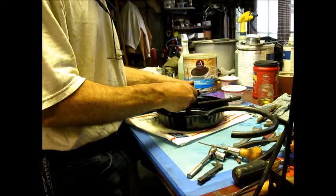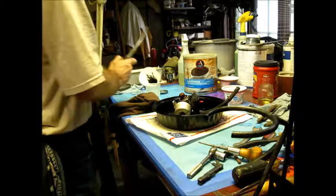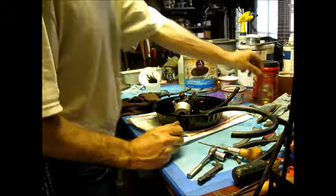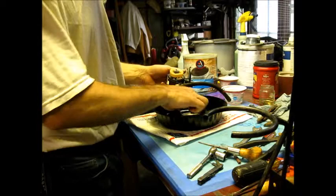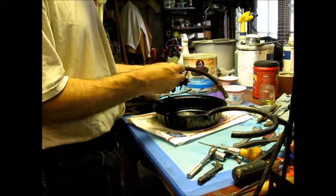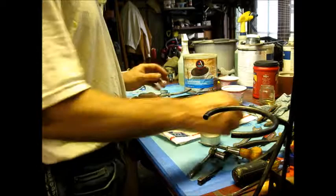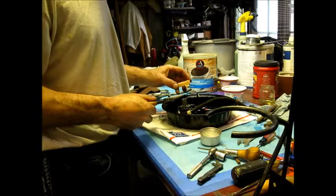Let's take a look at the jet. Jet looks pretty good. Okay, we're going to put it in our low pressure blow. This is that stuff I was using earlier, the Lumabright. Okay, so now notice which way it goes. This looks really good. There's no junk in the bottom. This has been cleaned a little bit. Somebody Scotch-Brited that. The guy that serviced this did a nice job. I don't see anything wrong here. Probably ran fine. Not sure what happened with the motor burping up like that. Maybe he pulled the motor and forgot to tighten it well. That's not uncommon. People forget things.